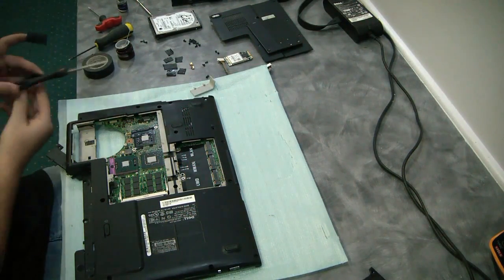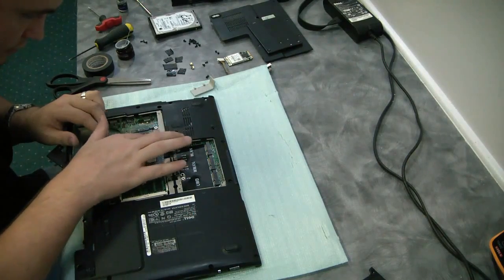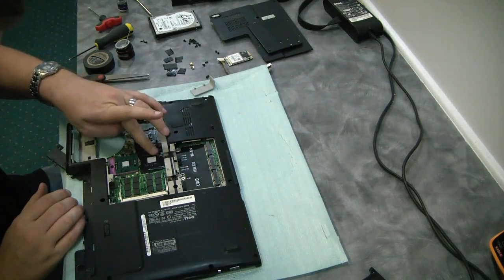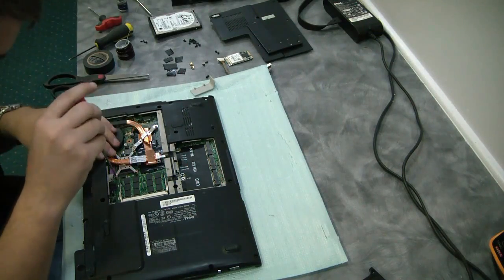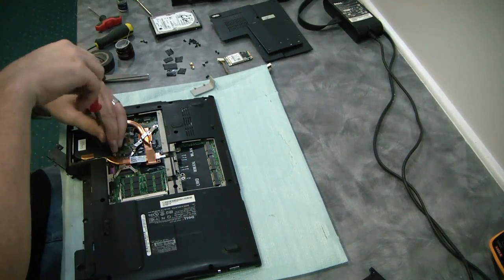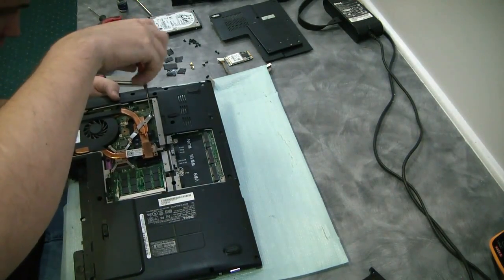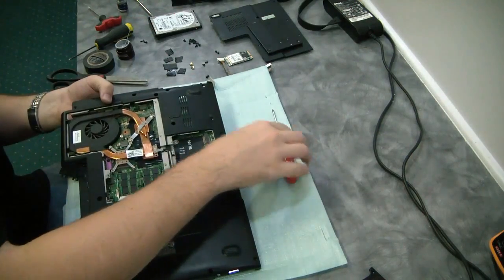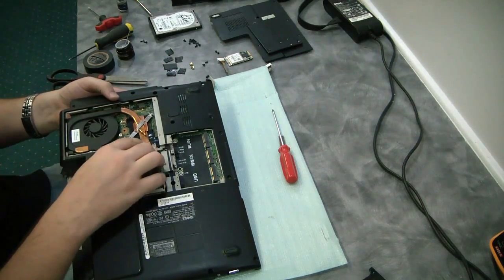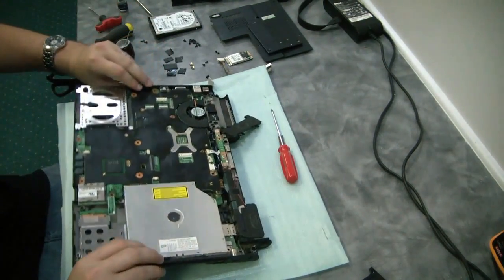It's a little bit over a mil — good stuff, it's just the way to go. When you test with a penny versus this copper, you'll see a good five to ten degree difference. It really does make all the difference. Have it snugged down, nice and tight — good contact to the GPU and CPU. Good thermal grease, better thermal grease, even better. Something like Arctic Silver, just anything a little bit above that white stock stuff. Usually you're fine. That and good copper and you're in good shape.